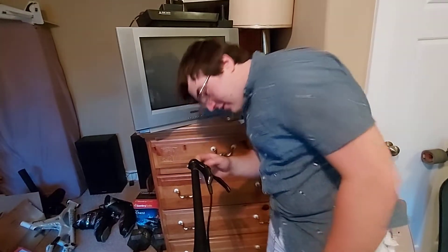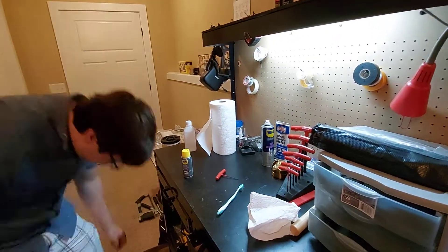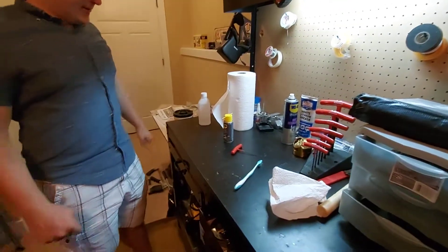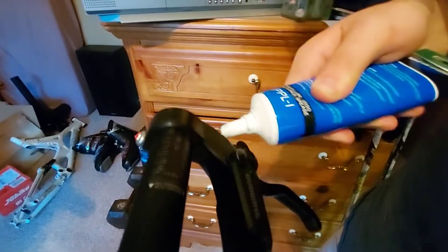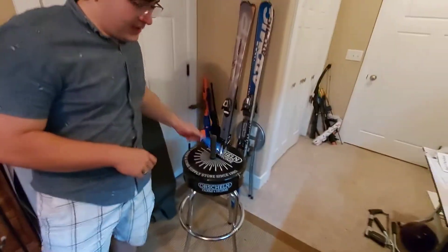I would imagine this is now nice and clean and pretty good. We're at 13 minutes — this video is long. I'm going to get my grease and just grease these threads a little bit. I don't know if you need to, but I've always found it's good practice anytime you have threads on a bicycle. It's a good idea to grease them, because most threads on a bicycle have direct torque applied to them.